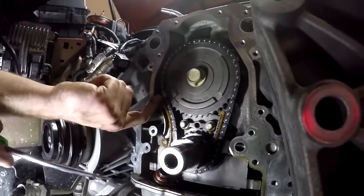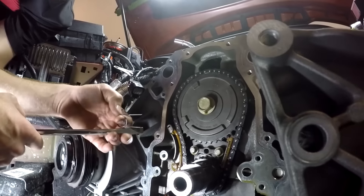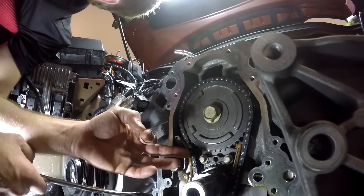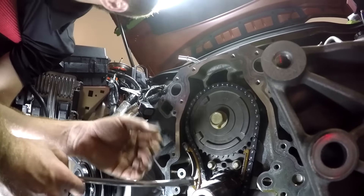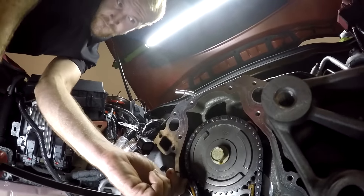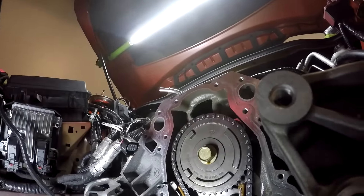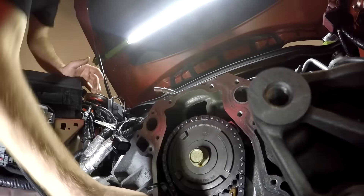There's going to be a little pin right here to lock this little tensioner in. It's also very brittle because it's soaked in oil all the time at excessive temperatures. That's fantastic — now this is locked, so we've got slack in our chain. All that's ready to tear down.